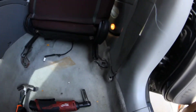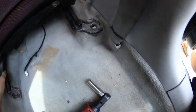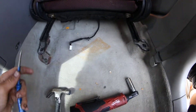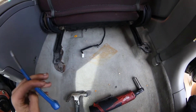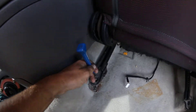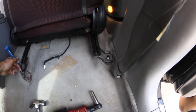There's a little tab right here on the center brackets that will actually line up with that hole. And you see it is pretty far off of both holes, so what I'd suggest doing is getting a punch like this, punching holes about in the center — like right there probably — and then drilling it out with a half-inch drill bit just so that you're able to fit bolts through.